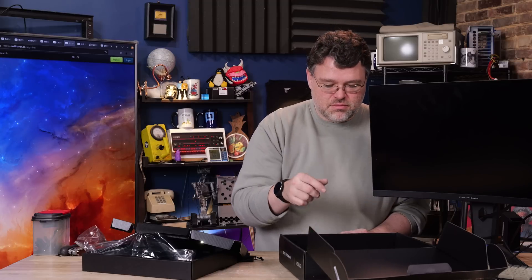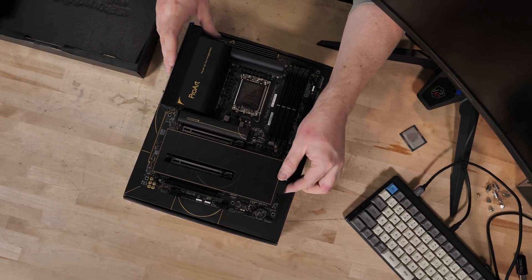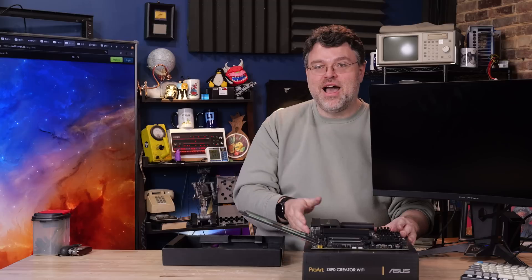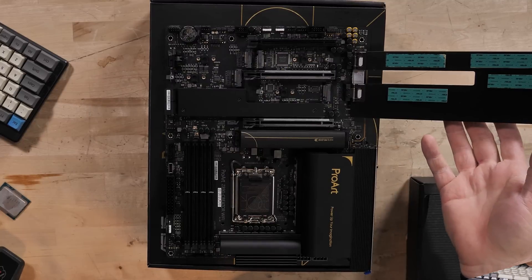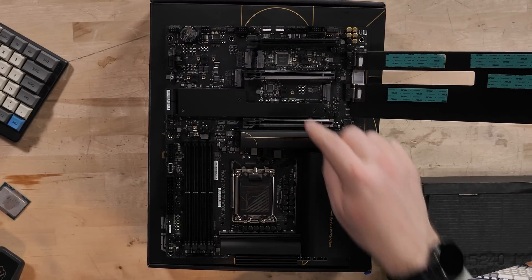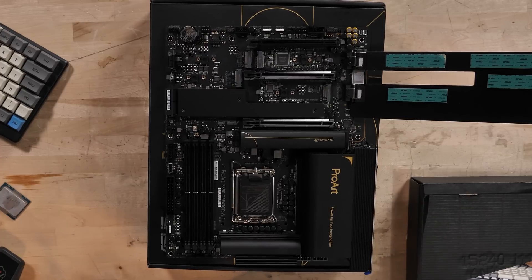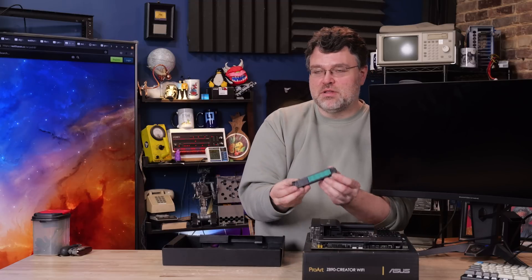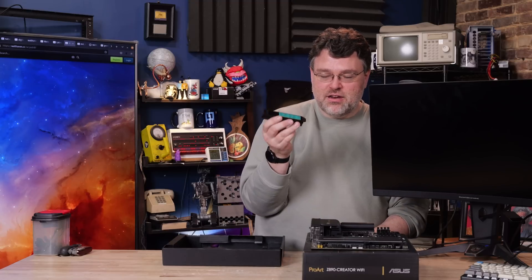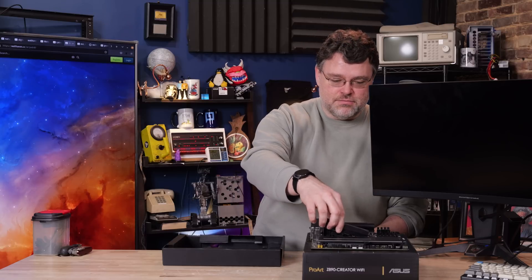It's a very nice hinge — heat absorption on just one side of your M.2, but that's completely fine. There are little rubber standoffs you can use. You've got four 80mm M.2 slots — two here, two here — plus your Gen 5 M.2, which is also a quick-release. And this one is double-sided thermally, so this would be good for that T705 double-sided Gen 5 M.2.